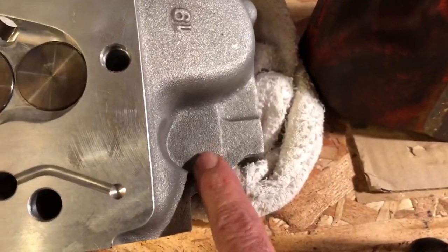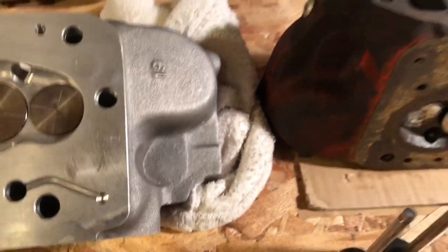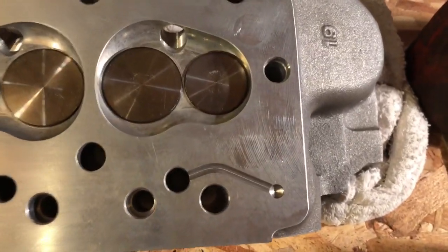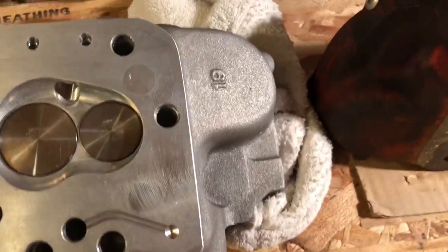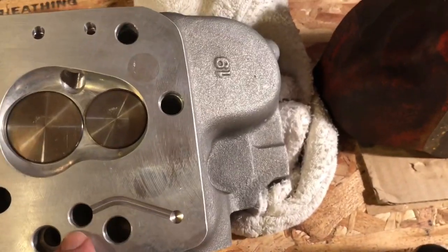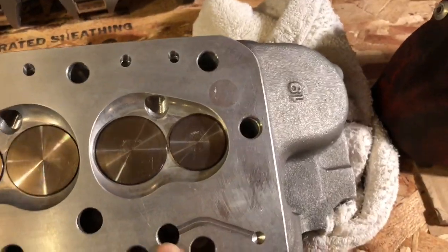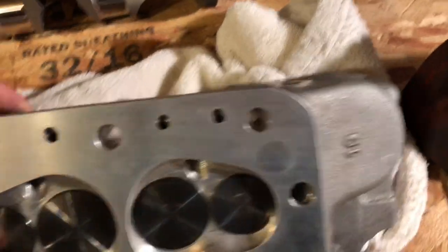On the aluminum head they've done away with the bypass hose — most water pumps you can find a nice way around that now, so one less thing to fail. Similar to the Pierce head, they bring the oil up the head stud into the bottom of the rocker assembly rather than having bores through the head.